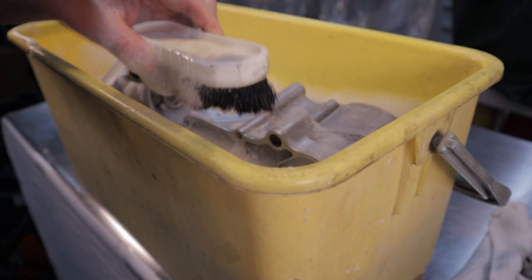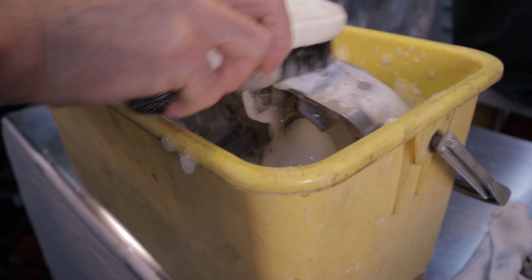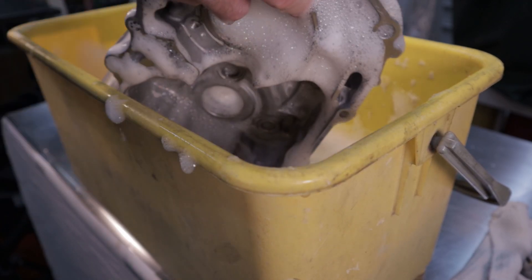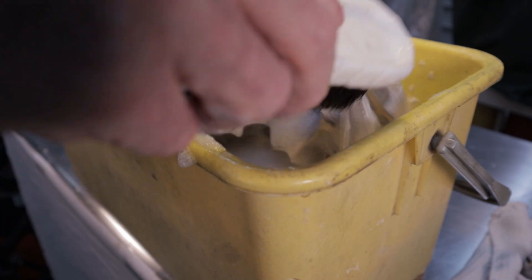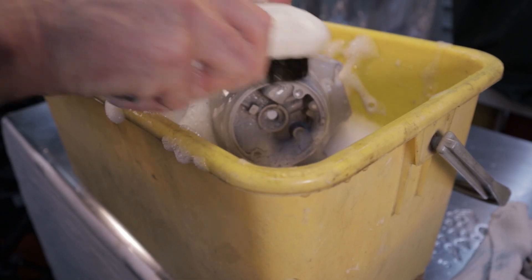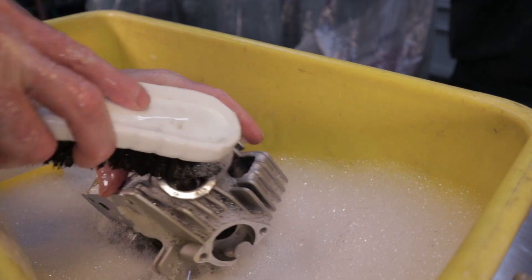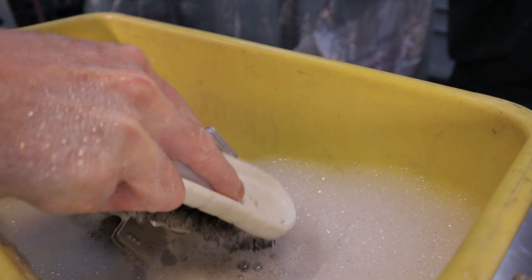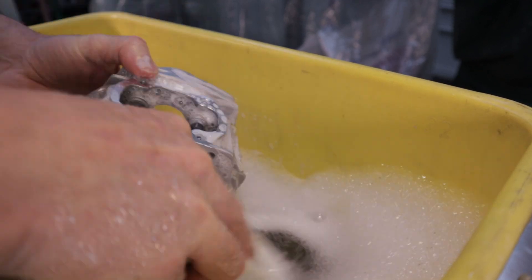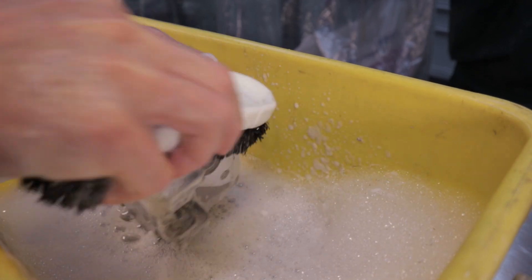In my case I sent all these parts off to vapor blasting first and had them cleaned up really good by Houston Vapor Blasting. I also put them in my ultrasonic cleaner and let them soak for some time. Finally, I always go over them with soap and water — I only use Dawn dishwashing soap, which is by far the best degreaser for this type of work to get off all the chemicals from the ultrasonic tank. On a pit bike you've got to really spend your time getting inside the fins scrubbing like crazy, because a little bit of oil in there would definitely make it so the Cerakote won't stick.